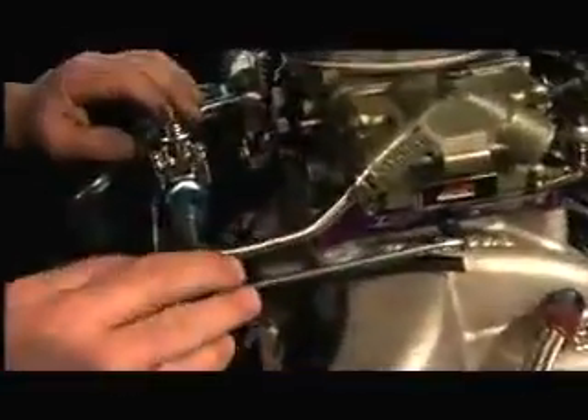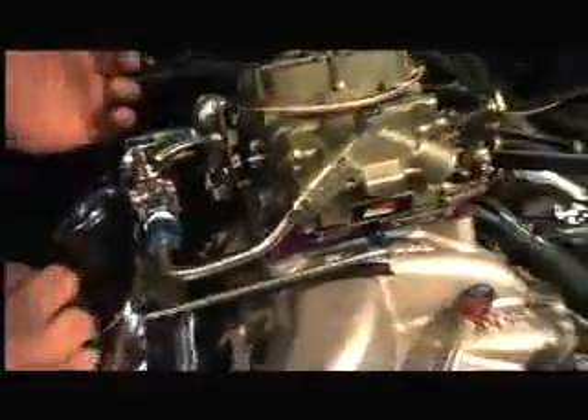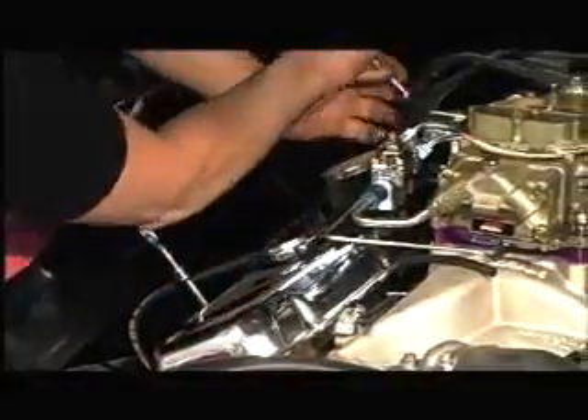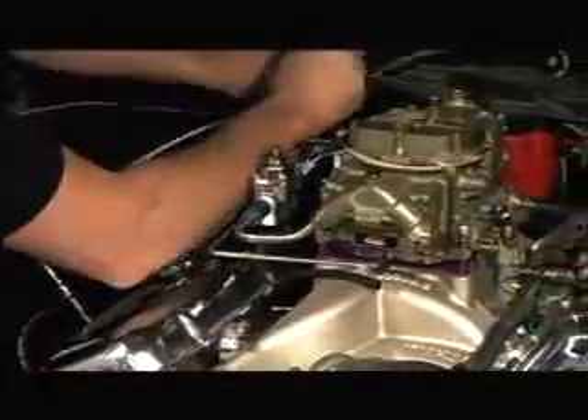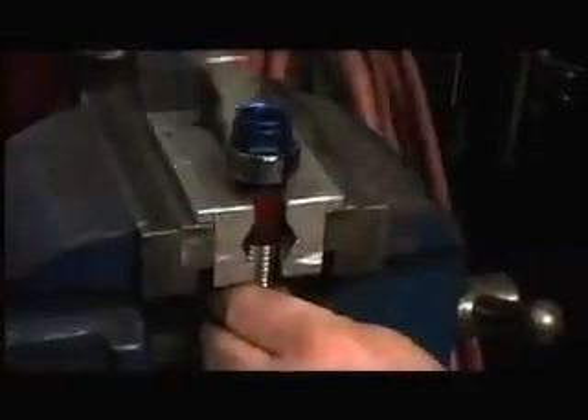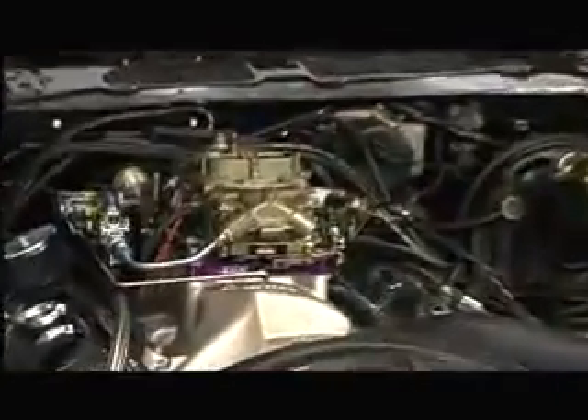The reason I like to use the stainless lines is not that it's necessarily better — it's actually simpler to use the lines supplied with the kit. I like the fact that we don't need any bracketry to hold any of this stuff up; it's all mounted off the stainless lines and it's strong. Nick ran the nitrous feed line up the firewall and connected it to the nitrous solenoid behind the carburetor, then measured a new line from the new Holley fuel pump to the regulator, cut it to length, and fitted a new hose end. Attaching this line completed the fuel system upgrades.